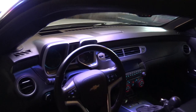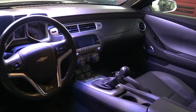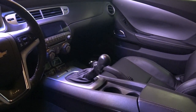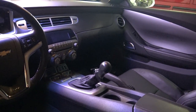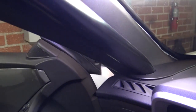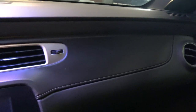We really wanted to maintain that stock feel of the interior. This is an automatic but we kept the stick shifter, rebooted it, and made it look like a stick with a four-speed pattern. The cage — if you look at the dash, you can see how tight the cage hugs the pillar. We cut the dash and made a little panel so it's not really that noticeable that it's caged. From the outside you really can't even see the cage.